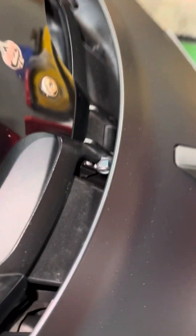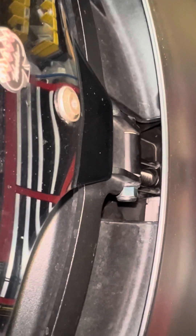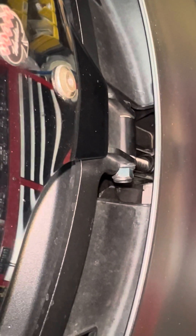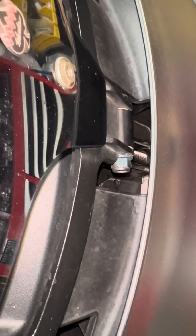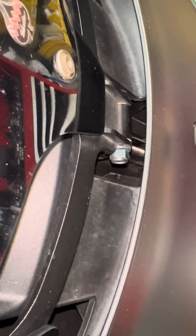I'm going to show you the worm drive is still working — the motor is working in here. Zoom in on that. And yet it's stripped out, it's not working. The plastic nut that connects to this worm drive will strip out on every powered windshield on an Indian. We've got a CNC replacement part that will replace it metal on metal and won't wear out.